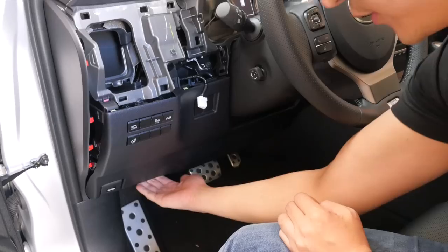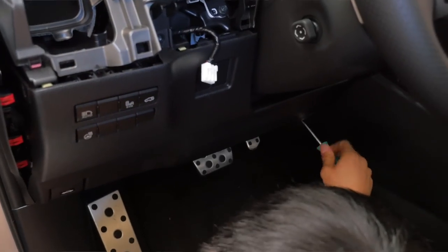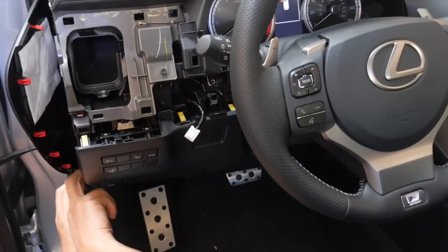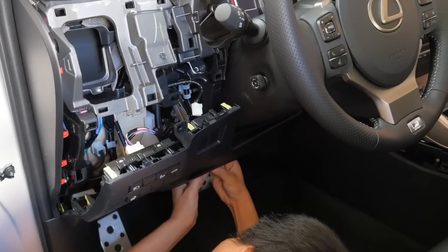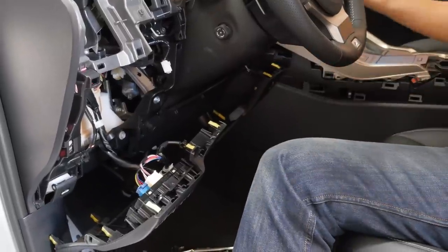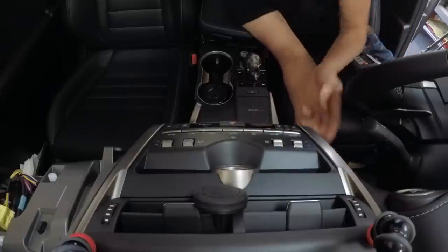Make sure you don't lose that screw. Duck under and remove the two Phillips screws also holding this panel on the bottom. Once you have those removed, hold on to this and drop this panel. Once dropped, you'll find a small panel between the start button and the panel we just dropped — remove that too.